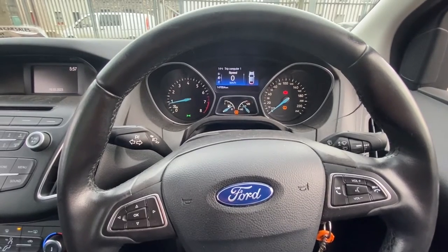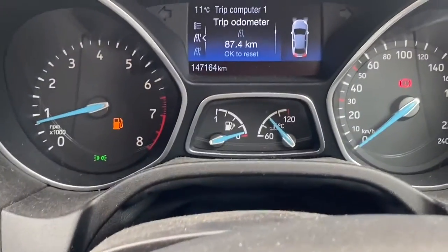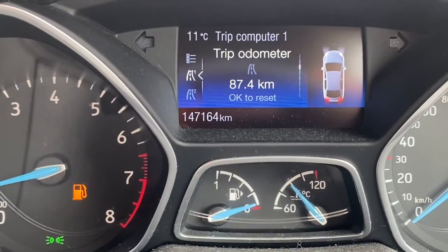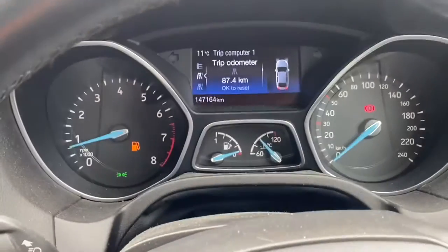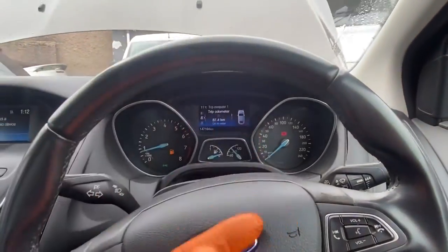We're nearly empty on fuel. About 100 kilometers done in this thing and everything is doing as it should be. Bonnet is up — coolant level is fine, no steam at the back. Before I had bellows of steam, now nothing. Coolant level is staying where it's meant to be and oil level is okay. It's been changed. She's working — she's done.